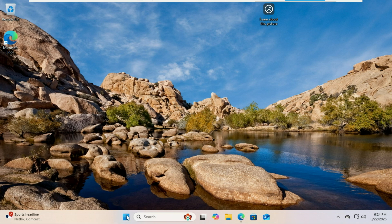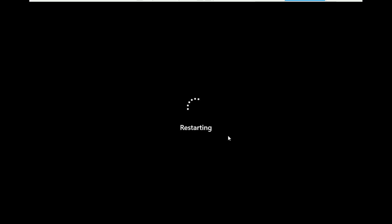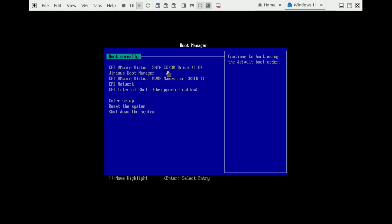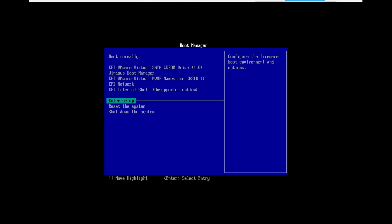The installer is ready on our hard drive partition — now we need to boot from it. Restart your computer and press the key to get into your UEFI/BIOS firmware settings; this is usually F2, F9, Escape, Delete, or F12. Once in your UEFI, do two things. First, ensure Secure Boot is disabled — it's often under the Security or Boot tabs.